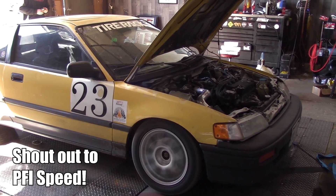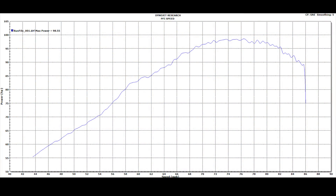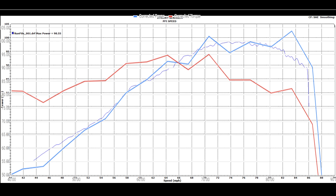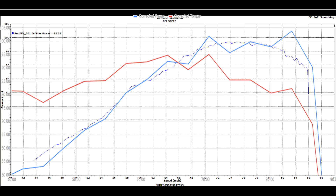We'll compare this information to a dyno run I have from a couple of weeks before I took this data. It's actually pretty close — using my scales and reading the tachometer, I can get within about 5%, which is relatively close all things considered. The plot shows some jagged peaks, just a result of the tachometer readings not being perfectly consistent, but overall this is a fun way to estimate how much power your car makes without paying for a dyno.